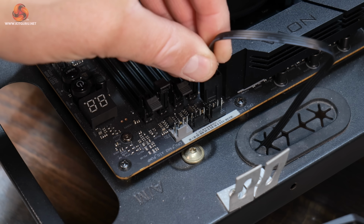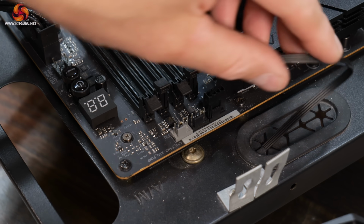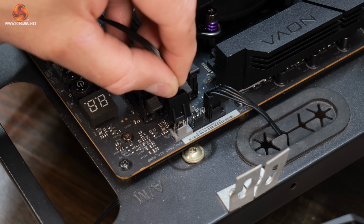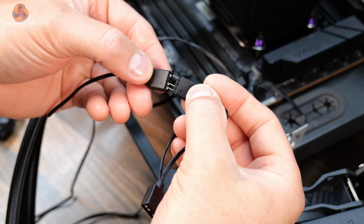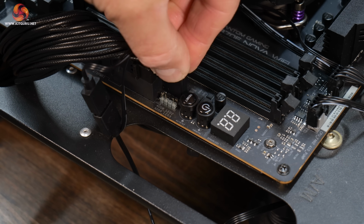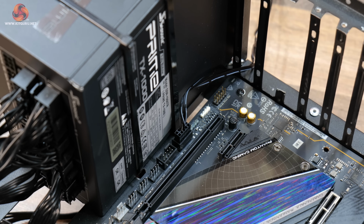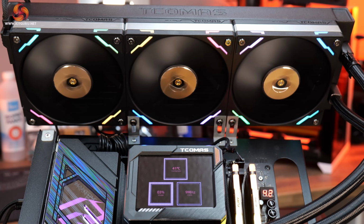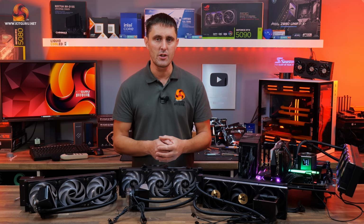For the wiring, all models need the PWM cable from the fans connecting to a motherboard PWM header, usually labeled CPU_FAN. The pump connects to another PWM header, usually AIO_PUMP or CPU_OPT, and the RGB cable is connected to a motherboard 3-pin 5V ARGB header. For the LCD screen models, you will need to connect the USB cable to a spare USB 2 motherboard header, but once you've mounted the radiator in the case, that's the installation complete.